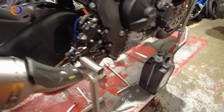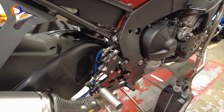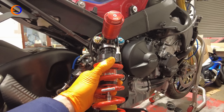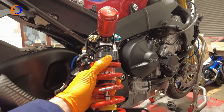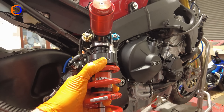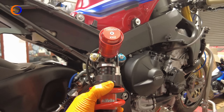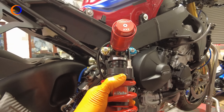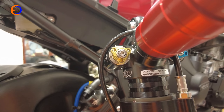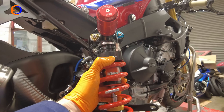This is an ideal time to figure out which bits of linkage you have to take off — it would be a bit of a faff doing this 10 minutes before a qualifying session. Interestingly, the data Honda gave me as their recommended base setting is basically the same shock length and nearly the same spring rates as the standard road shock — goes to show Honda did the correct thing originally. This shock is a tiny bit softer sprung than the original Öhlins shock, but it's only designed for one person not two. I've re-measured the spring and written down exactly how long it is, because when you're doing preloads half a millimetre actually makes a difference when you're as fast as Franco. I've double-checked all the settings — preload and damping as per Bitubo's recommendation. These shocks have high and low speed rebound and compression: rebound on one side, compression on the other.